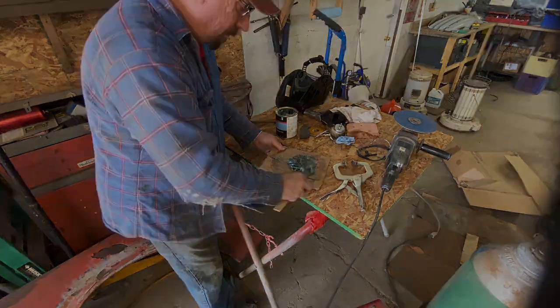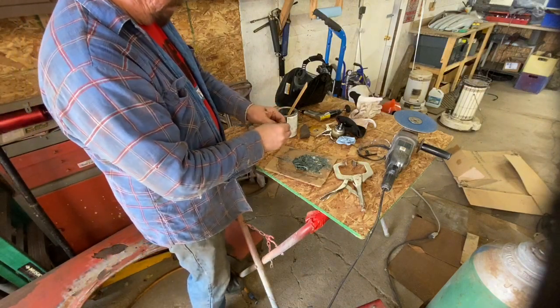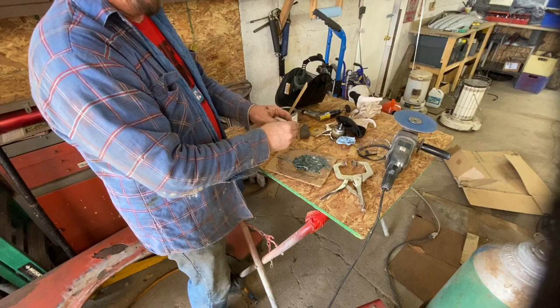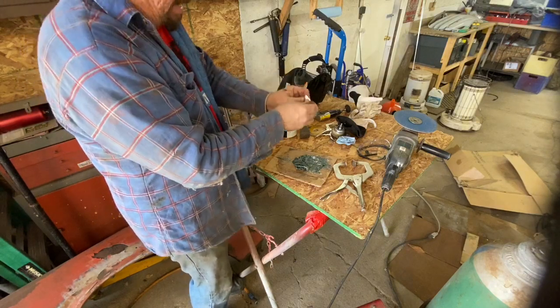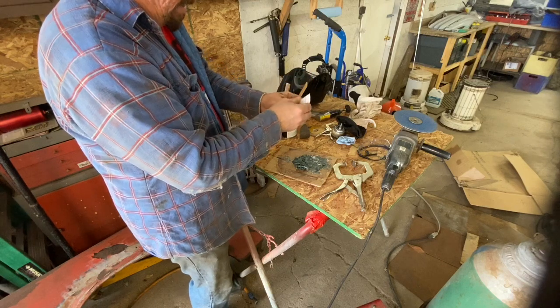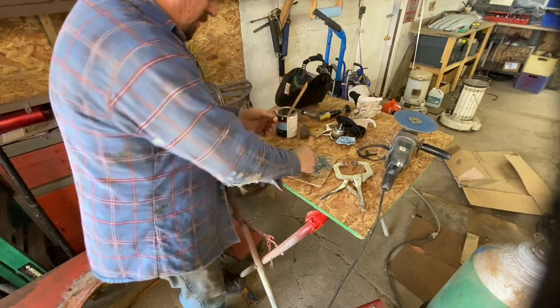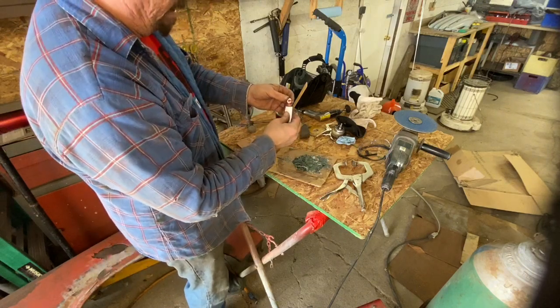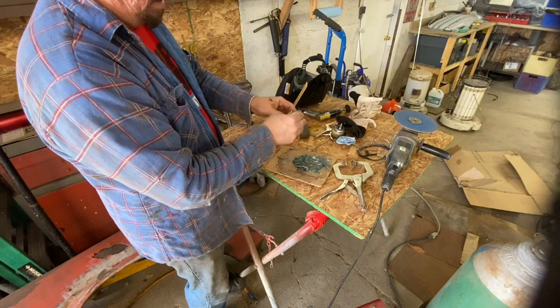Yeah, that looks good. First of all, with your hardener, make sure that you knead it real well. Especially if it's been sitting around for a while, it'll be watery. So take that tube, squish it around, especially down at the bottom, squeeze that up. Get it moving around in that tube. I like to squeeze some of the air out if I can. Whoops, too much. Squeeze some of the air out of there so that I can actually move the product around inside the tube.